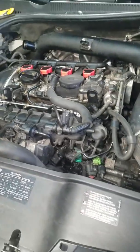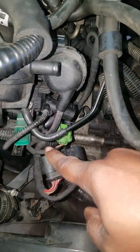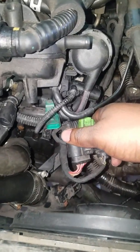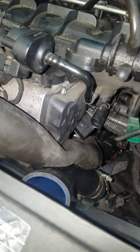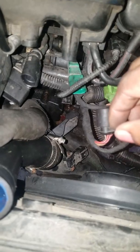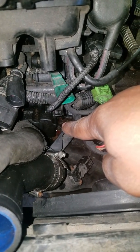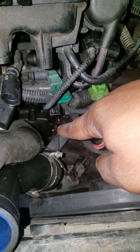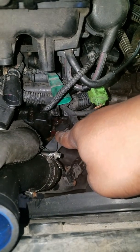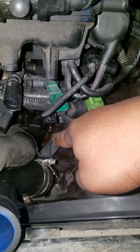I've done this video to show all you guys that have the MK5 TSI engine — CBFA or CCTA engines. I disconnected these two cables right here; these are your knock sensors, right up top by the intake manifold. You can see the throttle body and your N80. I disconnected these wires that were all right in here just to get all the way down. Right down here, straight down about a good foot from where the knock sensor is — down on the bottom, front of the engine, bottom right-hand corner — that shiny spot is where the G28 engine speed sensor is located.